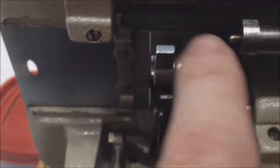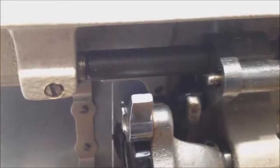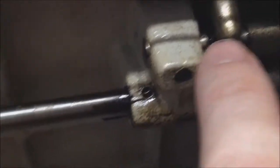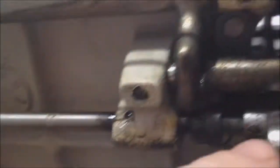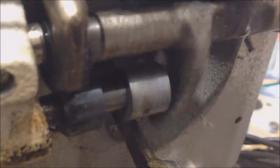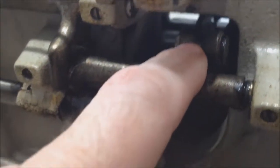Up here, you've got to get that shaft because it rocks. There's a cam right here you need to lubricate. I also lubricate this — even though it's a back and forth motion, it slightly rocks and needs to be lubricated right there. This is a moving point that needs to be lubricated. There's actually an oil well here for this shaft that goes through, and you also need to lubricate this one and this one, which is in a cam again. You'll need to lubricate the shaft on either side here, and this little cam here — you can definitely see it moving. Then down here there's this shaft, this shaft, coming over to the shaft over here, that shaft, and the bearing there as well. That pretty much covers everything that moves on the base.